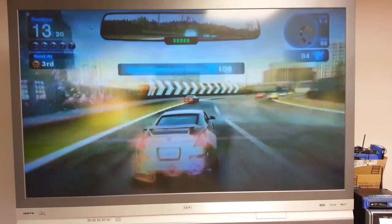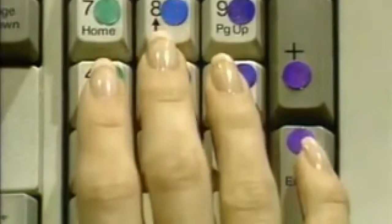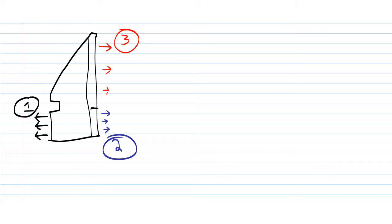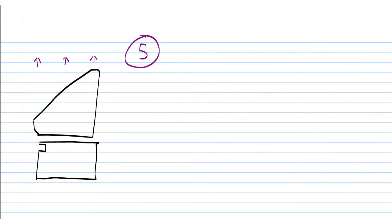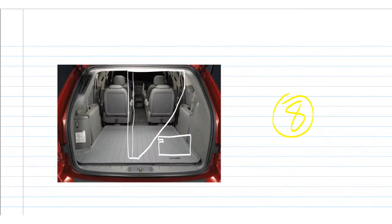Assuming I just needed a new lamp, I figured that it would be an easy $20 investment and a quick turnaround. The first challenge was transportation. We've never transported anything this large in our van before, and after a quick crunching of the numbers, I found that there was no way it was going to fit — it's simply too tall. After taking a closer look, I found that it could be partly disassembled and transported in multiple pieces. It basically just consisted of pulling the back cover off, removing the face plate, then removing the screen, which gave me access to the screws inside of the upper cabinet securing it to the lower cabinet. It was just a matter of removing the upper cabinet, temporarily putting the screen back on the separated upper cabinet, putting it upside down into the back of the van, and then putting the lower cabinet next to it right side up.